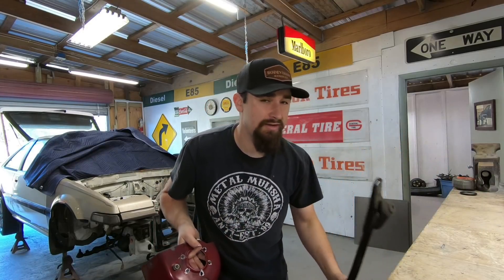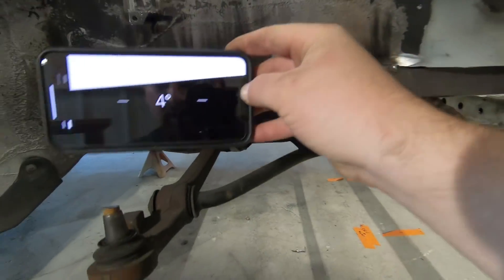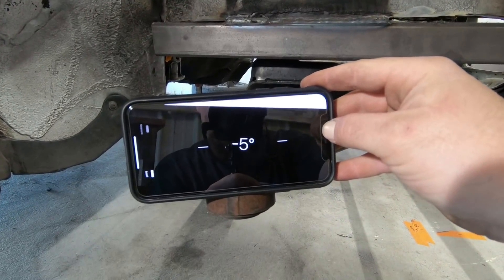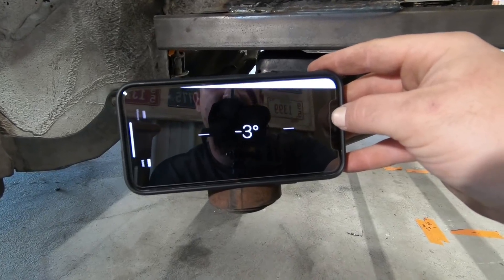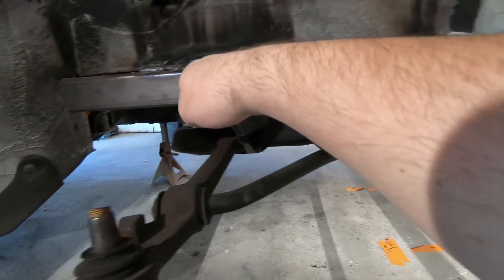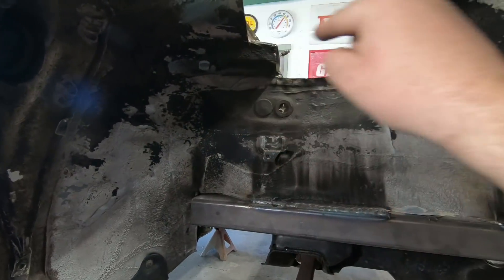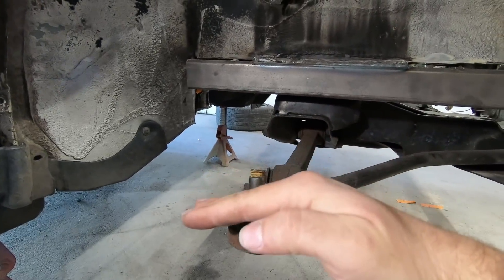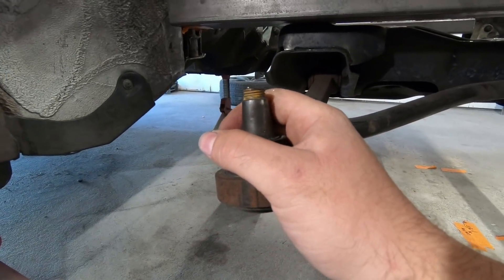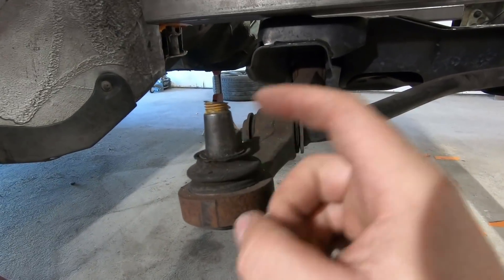These GTO strut tower braces are the key to camber and caster. Right now we've got the ball joint right there, zero degrees on the frame, and this is sitting at negative five degrees of caster — somewhere between negative four and negative five. That's exactly within spec of how GM designed it. That means the top of the shock has to match this angle — it's got to come up straight and meet the top at a 90-degree angle. The top angle has to match the angle of the lower section to get the perfect caster within spec for our suspension geometry and to make sure Betty White drives as good as possible.